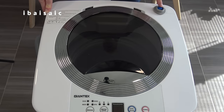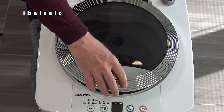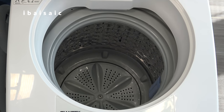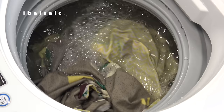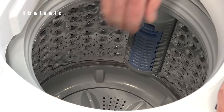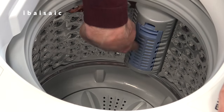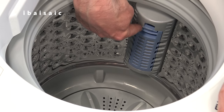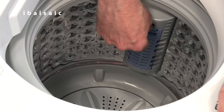This is the top of the washing machine. Here's the water inlet where you connect the pipe which connects to your tap. This is the lid you lift up to give you access to the washtub. The washtub's capacity is approximately 3.5 kilograms or 8 pounds of dry laundry, but we'll see in practice how much that actually is when I do the demonstration. The bottom of the tub houses the agitator or pulsator that rotates in the water to wash the clothes. The side of the washtub is made of stainless steel and it's perforated to allow the water to be extracted when spinning. This has a rated 750 rpm spin. You'll also notice on the side a little blue filter, which is a lint trap that traps any particles of lint and fluff.